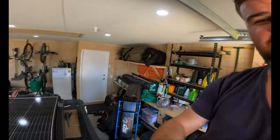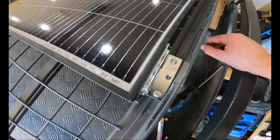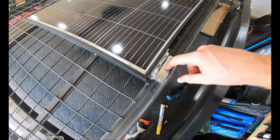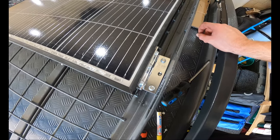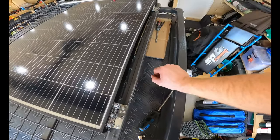Yeah, when drilling into steel, I'm trying to put self-tappers in. Pre-drill your holes, because I've snapped the tech screws off a few times now, being lazy. And then I haven't been using big enough pilot holes, so I've snapped four tech screws out, and then drilling them out, they're like a harder tensile, and I messed my drill bits up.